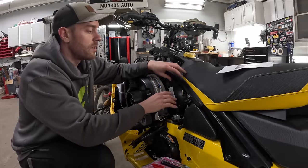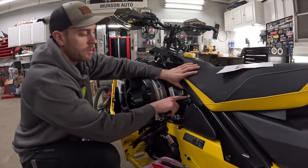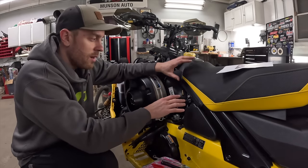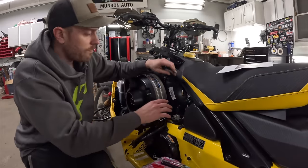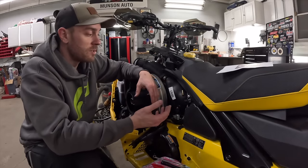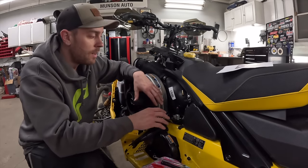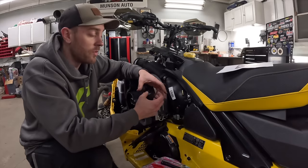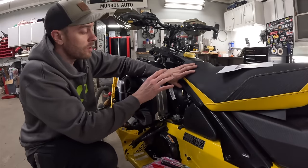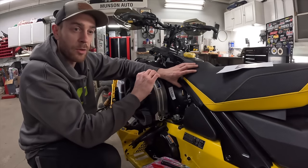So I hope you can see in the time lapse there that the fitting was a little bit tricky to get started. It was a little close on the brake hose retainer here that's riveted on. Again, I was kind of precise with my marking and maybe I was off a little bit, but just keep in mind that you're tapping this on the tight side of the tap, right? So you're using the 5/16 bit instead of what you would normally use, a 21/64, going into metal. Going into plastic, you need this to be a really tight fit and you need those threads to be as deep as possible so that it actually holds under boost pressure. Doing so is going to make this fitting a little bit tricky to get inserted and get the thread started.